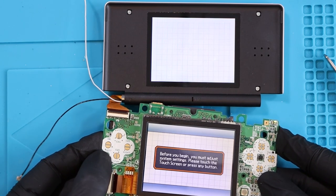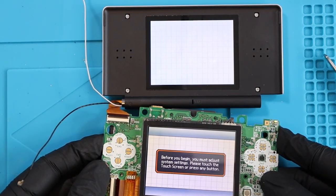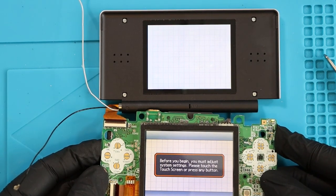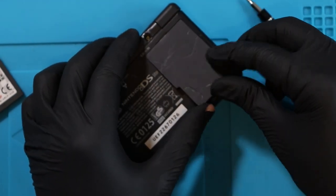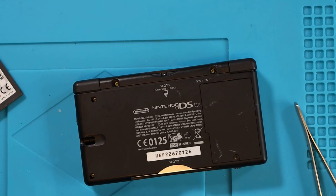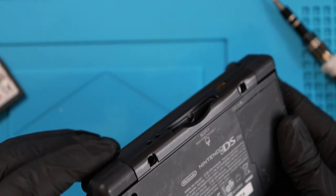There's still a little bit of brown marking on the top screen, but for the sake of repairing everything else, I'm more than happy to say that's fine - and when we play a game you can't really even see it. That took longer than expected. The R trigger wasn't seated properly because of a bend in the case, so it wasn't sitting properly and was wiggling around all over the place. I wanted to make sure I put it back absolutely perfect.